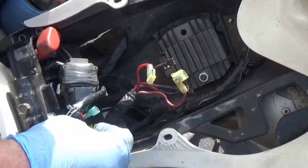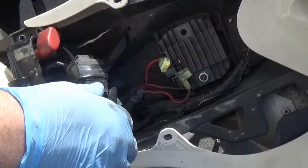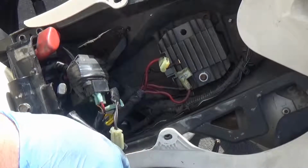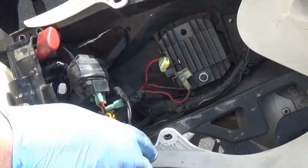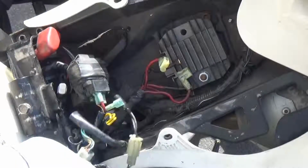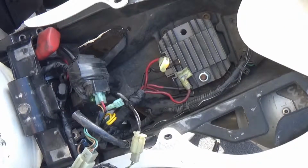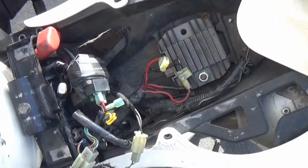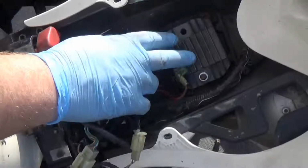And then I'll have to hook it up the way I feel is correct and see if the fuse still blows, if it still has a huge contact to ground. If it does, then he's going to need a new regulator rectifier, preferably the Honda one, right? But if he wants to put this Yamaha back into this Frankenstein, that's on him. Apparently if you get a Yamaha tail end, you keep everything. But I don't think the regulator rectifier is in the tail end on a Yamaha.